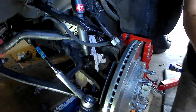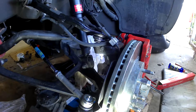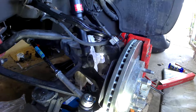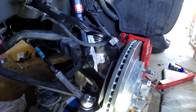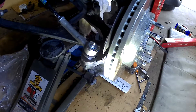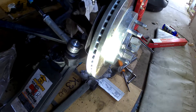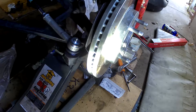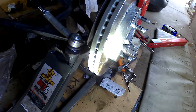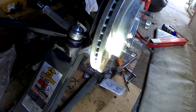I'm going to go ahead, just so we don't stress that shock, and jack up the control arm. Now the nut for the shock is a 14mm so I'll just use a gear wrench. I'm gonna put this in a little bit. Closer I can get to there, the better it'll be. That pulls up our shock a little bit more naturally.